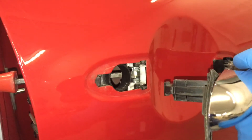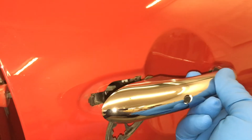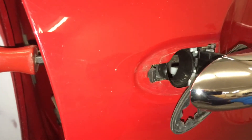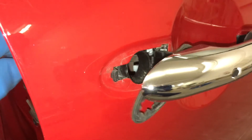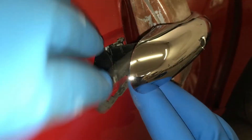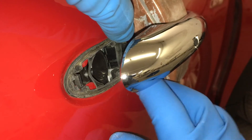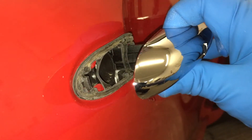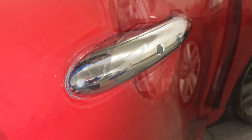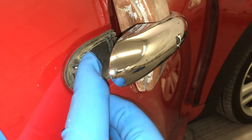To install the handle it's a lot about feel. Plug the wires back into the handle and insert the front and rear of the handle into the door, trying to simultaneously line up the front end to its receiver and the rear of the handle into the fork lever. When everything is aligned, pull the screwdriver straight out and the handle should snap into place. The gasket should be left on the handle until it is fully locked into position so it's not in the way — it can then be slipped on afterward and pushed into its keepers. Then prop the handle out with a rubber block, slide the retainer plate into place, and tighten the fastener bolt.